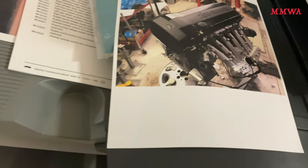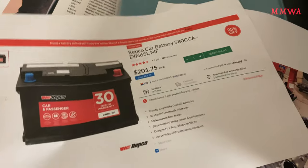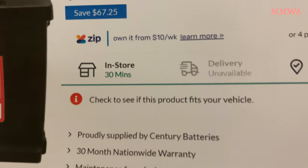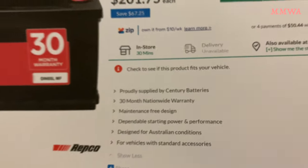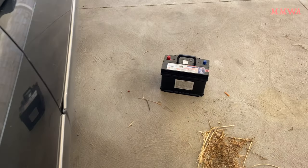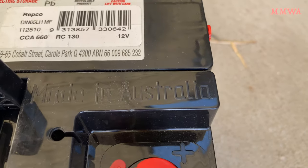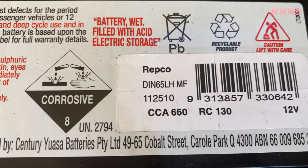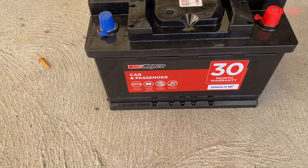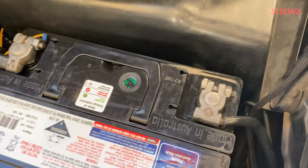It's been a while since I've had the chance to get my hands dirty working on 124s, so I decided to do a bit of shopping this morning — it was time to buy a new battery. It was either going to go into red or into blue black. This is the size battery that's in blue black, but you can actually put the LH version in. The difference between the vanilla DIN 65L and the DIN 65LH is the height, and the 124 is more than capable of fitting the LH version. For about five bucks more you get about a hundred cold cranking amps more and it fits perfectly — just like a glove, and the terminals are a perfect fit as well.